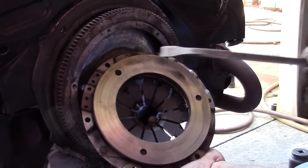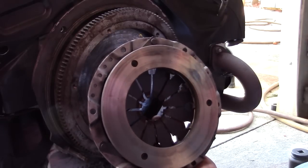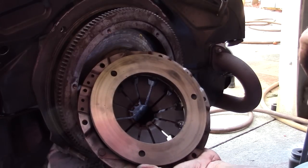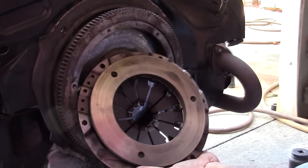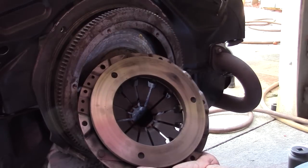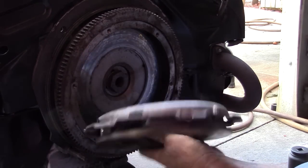Clutch parts have a lot of strain on them. The average passenger car, you're dealing with probably 900 to 1,000 pounds of pressure from this diaphragm onto the disc. In a race car like my drag car, it's 2,600 pounds. The only way you get away from pressure is running dual disc. You can reduce the pedal pressure and get just as much grab. But with a single disc, it's sort of dangerous to lighten the parts up like this and expect them to work.